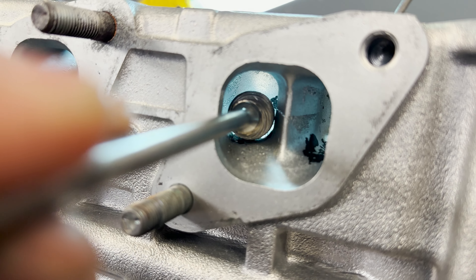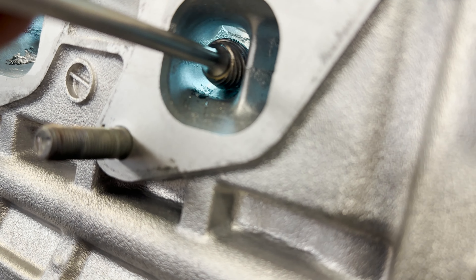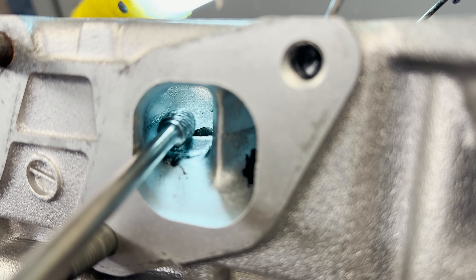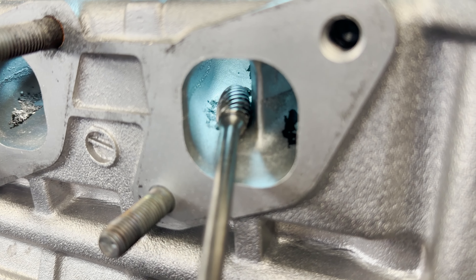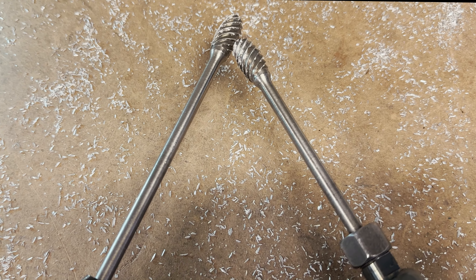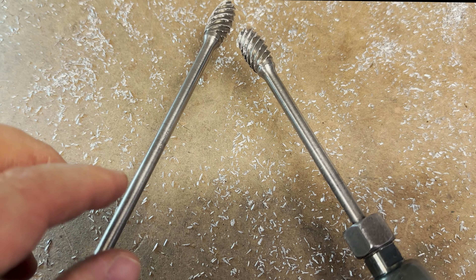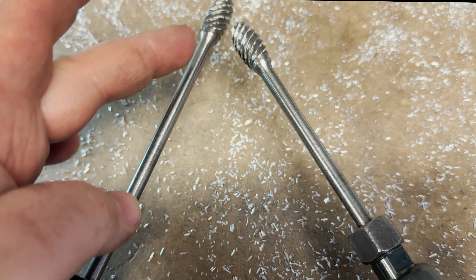Using that burr, you can see it really doesn't lend itself to having the right radius — the rest of the port just wouldn't work. And sometimes if you put it in and it's too small, it'll shake. But the half-inch burr is perfect. With the half-inch burr I can get everywhere in this whole port that I want to get. The first thing I'm going to do is knock the guide boss down and then shape all this — I'm going to keep the outside shape but shape all the inside. I'm going to use this one first because we're going to knock a lot of material out, and I don't want the deflection that the six-inch will have. The six-inch is awesome for blending stuff in and especially doing short turns — you really need the extra length — but when I'm trying to hog something, I want a shorter burr.